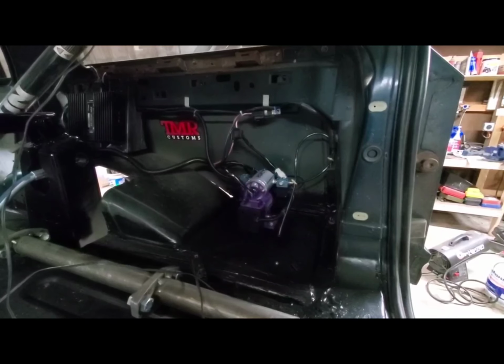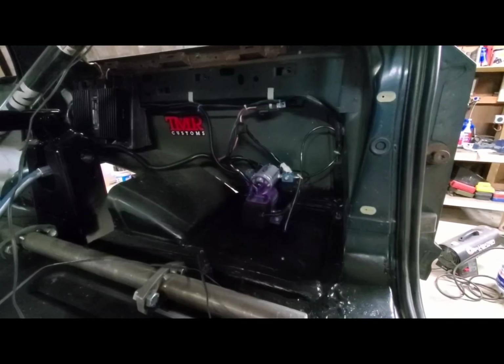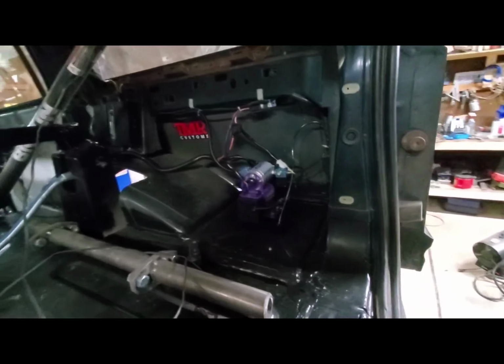So that's what's going on here. And then with the Yukon, and I guess it's the same with the ARBs, their compressors come with a harness, and the harness is designed to have a switch to turn the compressor on, and then two switches, one for the front locker, one for the rear locker. But it seems like with the way their switch is designed, the rear locker has to already be engaged before you can switch the front locker on, which to me is kind of weird. You should be able to control all that stuff 100% individually.